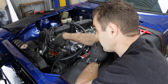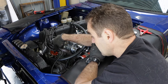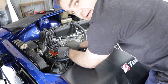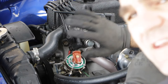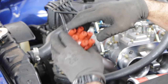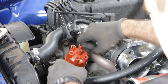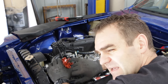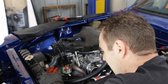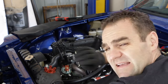The next most common suggestion was that I got the spark plug leads in the wrong spot, so number one lead is not in line with number one on the distributor. So let's take this off — there is spark plug number one right here. With it set up the way it's supposed to be, you can see the rotor is facing down. The trouble is that when I put the cap on, it's sitting pretty much midway between two terminals. I'm really thinking the location of the spark plug is not the issue — I think it goes a bit deeper than that. So what I'm going to try now is take the distributor out and have a look down to see if the drive is in the correct orientation.